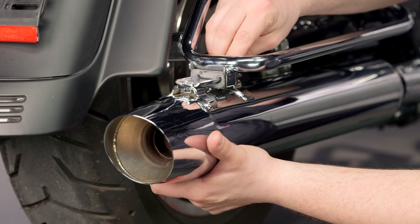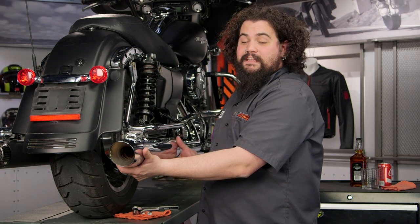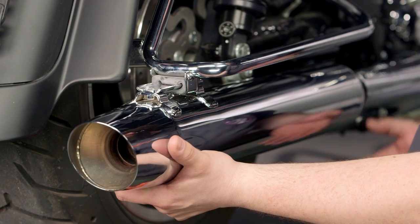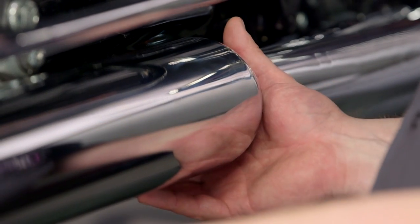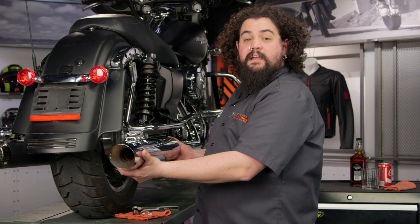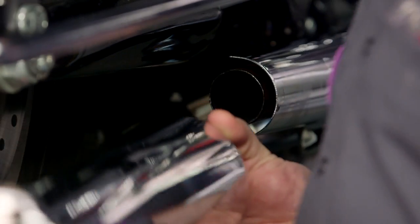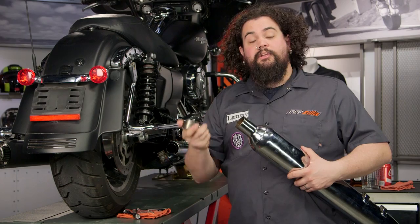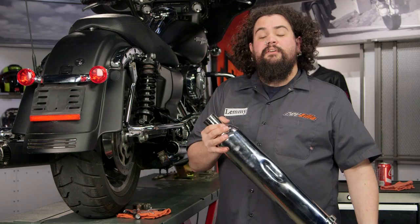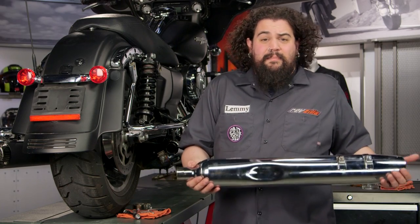We're coming up to what's probably the hardest part of the job: removing the muffler from the head pipe. Even though these are slip-on mufflers, sometimes they don't slip off very easily. You may have to put a little bit of muscle into them to back them off the actual head pipe. There's a fine line between getting enough force behind it and damaging something, so move it as little as you can so you don't beat up the head pipe. Corrosion and rust can work their way in between the joint. I like to rotate as I work things back. Once it's free, make sure you retain the Torca clamp from your factory muffler — you may have to reuse it, as some manufacturers include clamps but typically you'll reuse the OEM piece.